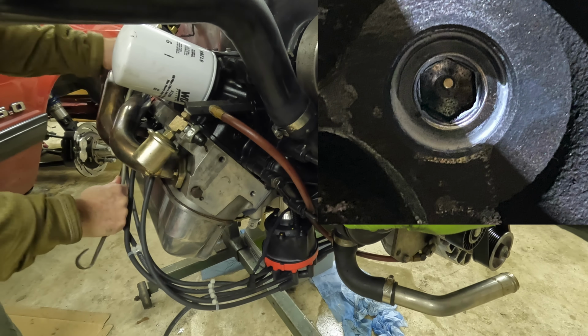So what we're gonna do is we have a new oil pump, the M68 Melling HV high volume. I'm gonna swap this one in. We got an oil rear main seal. We got a brand new oil pan gasket just in case. And with 5W30 oil, I am projecting that our oil pressure issue is gonna be solved. And if we can vary the weight of the oil to put the oil pressure right where we want it to be. So we're 2 hours to get the engine out.